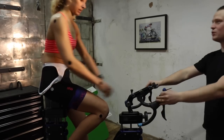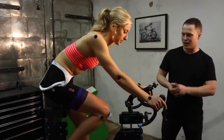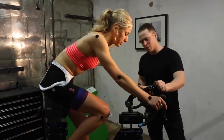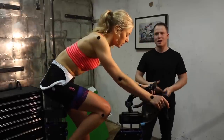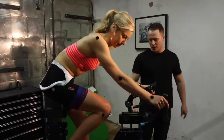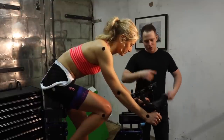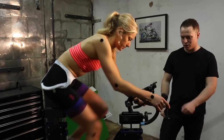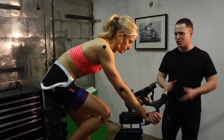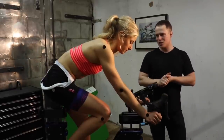Go back onto the hoods — a much more even feeling of weight across the hands. With a little bit of tweaking it doesn't take very long. With the stem out slightly longer and the hoods now sitting more across your hand, the shoulder isn't wanting to come forward like it was before. Go down to the drops and reach for the brakes — far easier. Build up a pedal stroke and move between drops and hoods a few times. That just looks a lot less awkward, a lot more comfortable, less pressure on your neck — all from just changing the drop angle and the hood position.